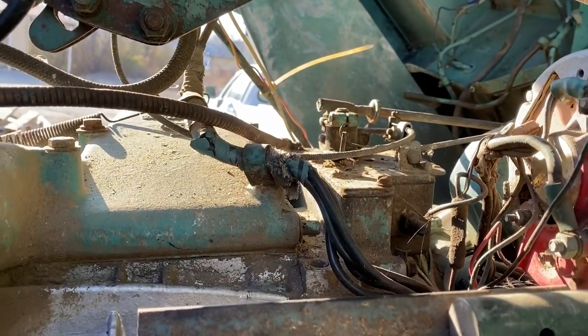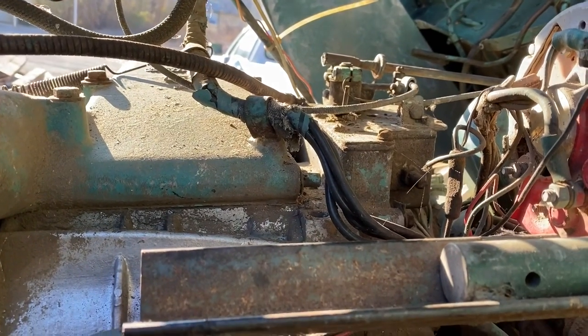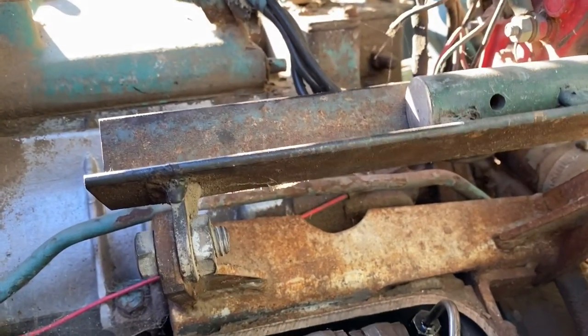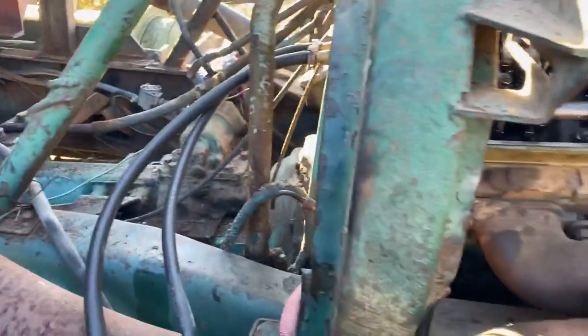It's going to need a new starter solenoid. That one we just got to replace. And clearly, it's not made for this. It's off of a, Tyler's not here anymore, but it's off of a Ford Power Stroke. So I mean, similar liters, but apparently the starters just aren't the same amount of power, the amperes that they're pulling.